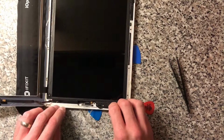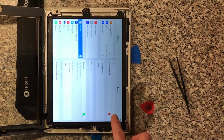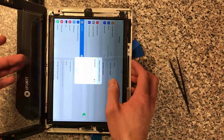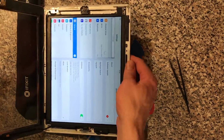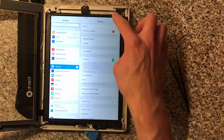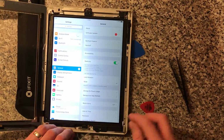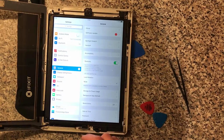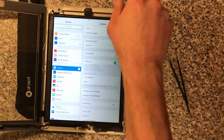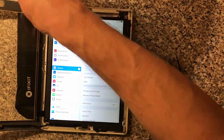Because we're not replacing the digitizer in this one. We're replacing the home screen, because you can see this side of it is all dark. Yeah, that doesn't work if you do it there. See all that side of it's all dark, like it seems to me like it's maybe been left on a radiator or something and the heat's caused that damage. So that wasn't why I got it. I got it to replace this, but you know, if we're going to replace that, we might as well replace the screen at the same time. It'll save some money on labour in the long run.